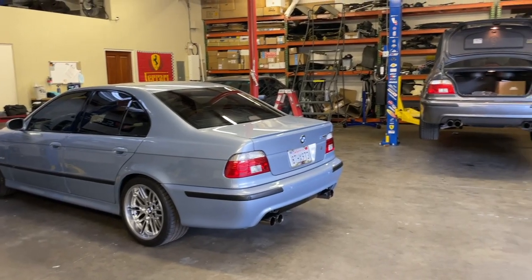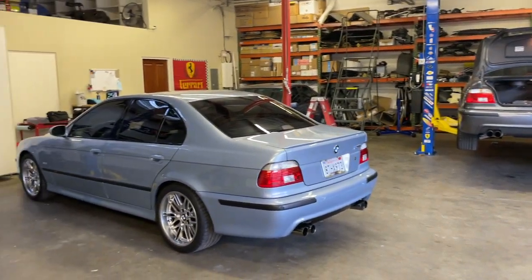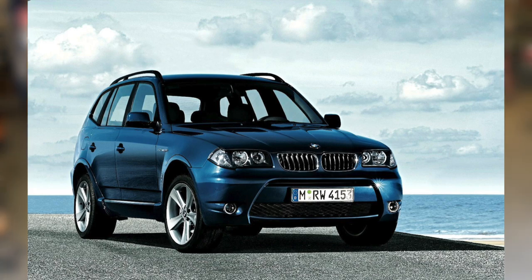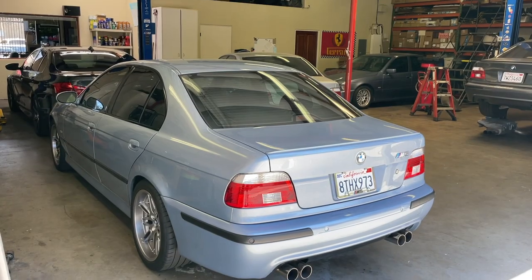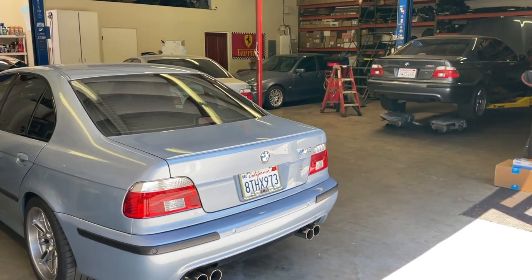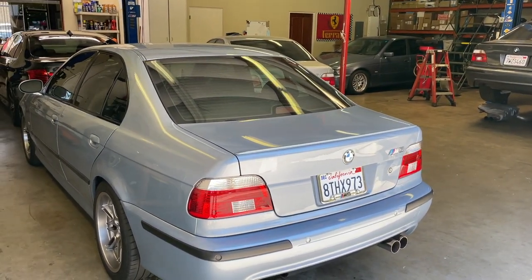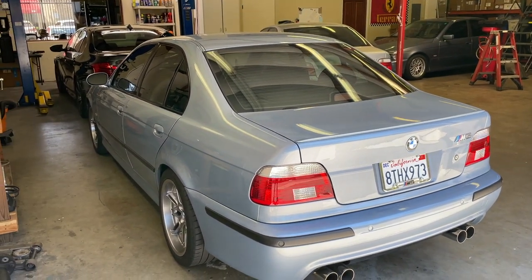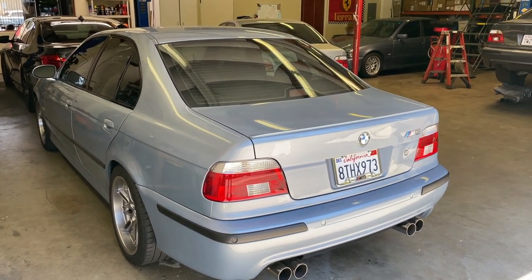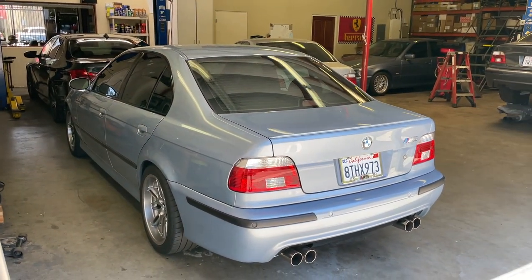A quick preface: this video applies to North American cars. European and rest-of-world cars unfortunately in most cases did not come pre-wired for the Blue Bus or the telephone. This will be semi-applicable to the E46, the E38, the E53, the E83, and the Z4 — but mostly the E39 5 Series. These cars were kind of put together by hand, so it depends which cable or harness the German guy picked up. You can't just give me the year and I can't just tell you what cable it is. There's a link below, and Ted's put together a pretty good table. But before you place your orders, you should be looking in your specific vehicle to determine which type of cable you need. As far as I know, there are three options for the E39.